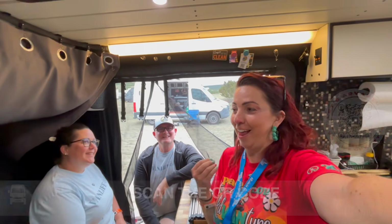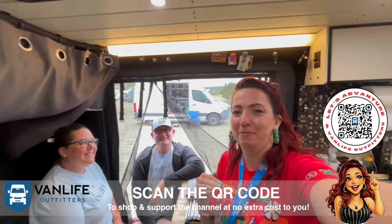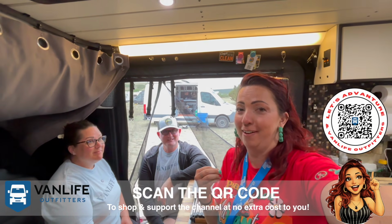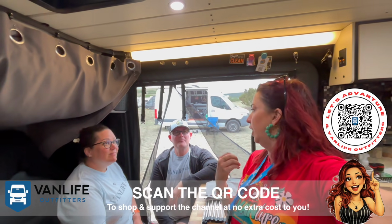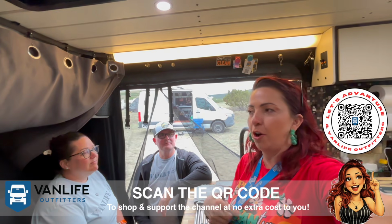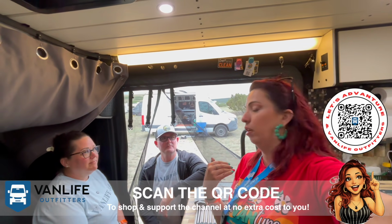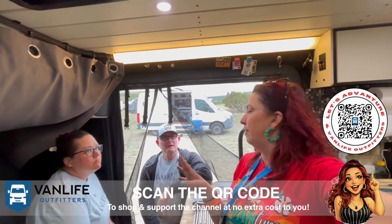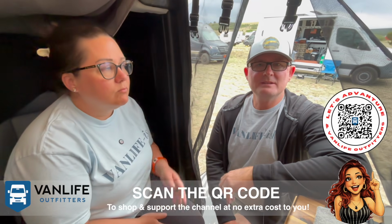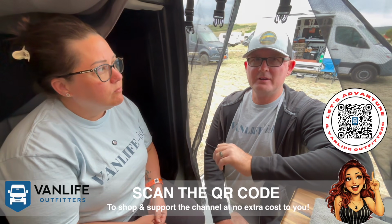So I learned a lot at Vanlife Outfitters today. I hope you all are watching the initial episodes of the season, because if you're planning your build, I had all these interviews with the experts at Vanlife Outfitters, and I learned today about the inverter, because I'm planning to have the same. I want an air fryer, microwave, oven combo, I want AC, so I'm concerned that I'm making the right choices to support all of that. You say you run all of that with no problems, what size inverter did you choose for those appliances? A 3,000 watt, 24 volt version of the Victron inverter.